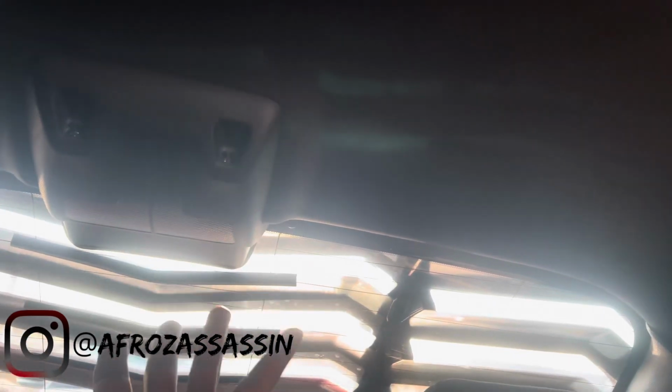So this looks like it's the Torx 20. I'll get that, and I'll pretty much have this whole side done. I could move on to, and I think I need to just slightly pry that down, but that just pops down. I don't need to remove it. I'll see how I'm going to run full access to it, and then I'll just get everything. I'll duplicate everything on the other side, and then the last piece will be this, and that just pops down, these little snaps, and then I should be able to get the headliner out.